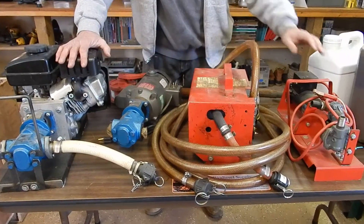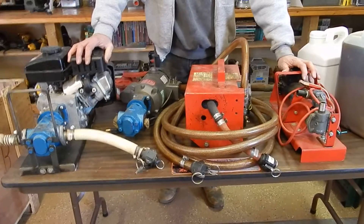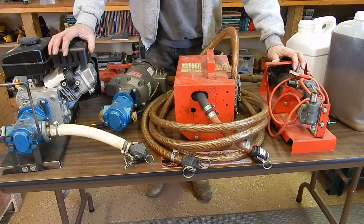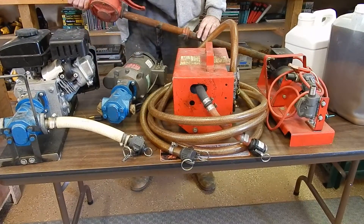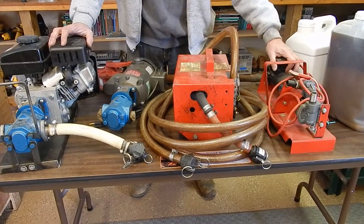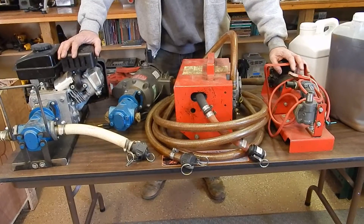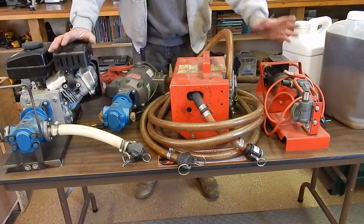These are the pumps we use. I'm not familiar with a bunch of others. I know Duo Diesel sells a brand; I haven't really tried them. The old pump I had petered out and I use that thing for everything. Motor oil — year-round these pumps are going to work for you. Veg oil — April to December they're going to work for you. The battery-op, I'd stay away from. To be fair, this is Redline's first generation — I'm not familiar with their newer ones, whether they're more beefed up and have a little more torque for moving the heavier oil. I don't know.